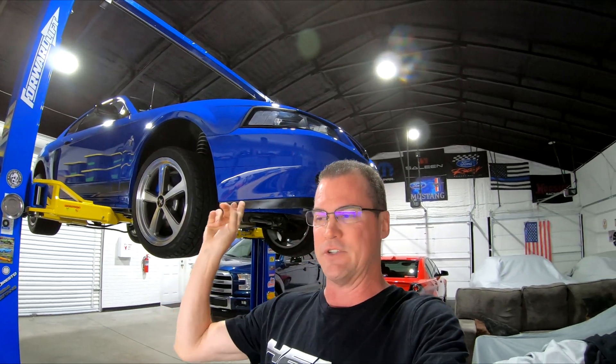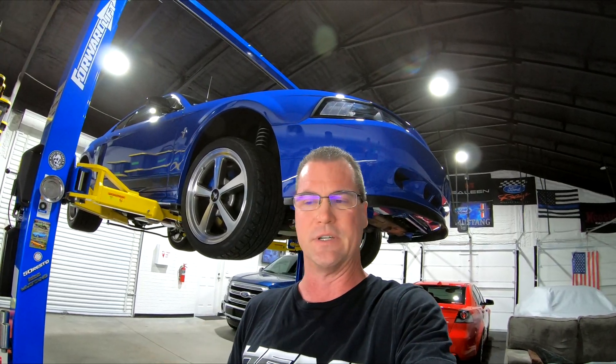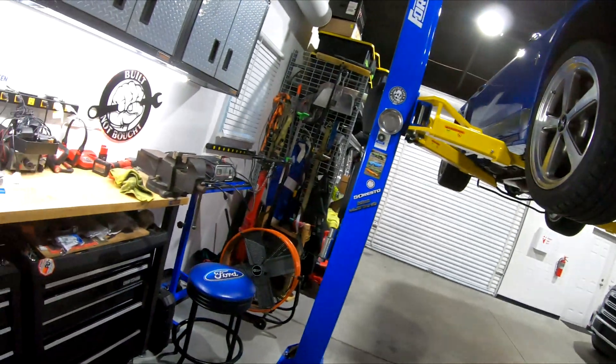First thing I did was open the trunk. It's got two fuses and two different relays that feed each pump individually. The fuses were good, both relays were good, but I went ahead, pulled the relays out, and swapped two other relays in — went out and got on it, and it was still doing it. So I've been putting off an issue for a while, and that is the feed line.